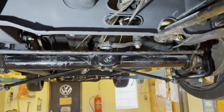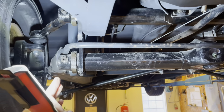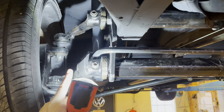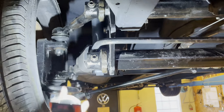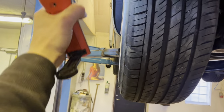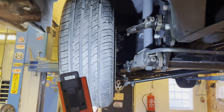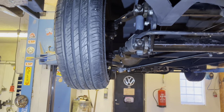A narrowed beam is where the torsion bar is cut down and shortened in width. I'd guess the original cap would sit about four to four and a half centimeters further out per side, so I've narrowed it by that amount. This brings the wheels inside the fenders so they don't sit right out at the edge of the front fenders.